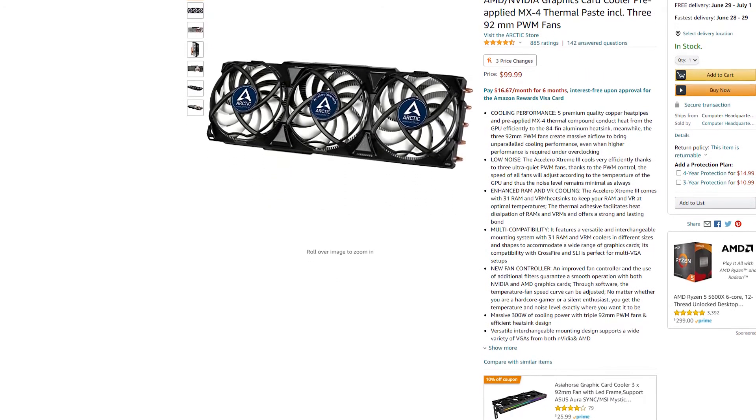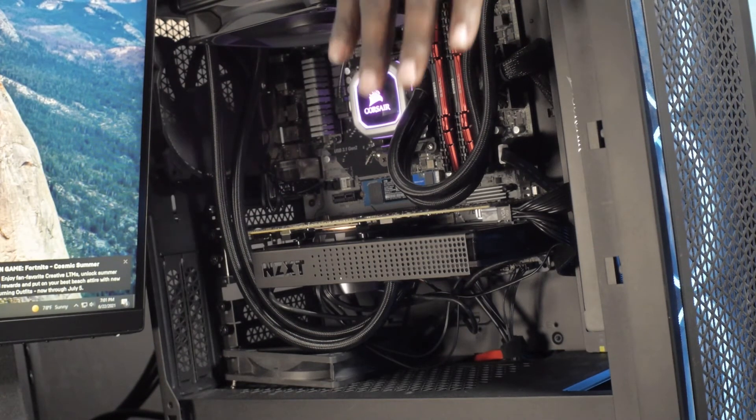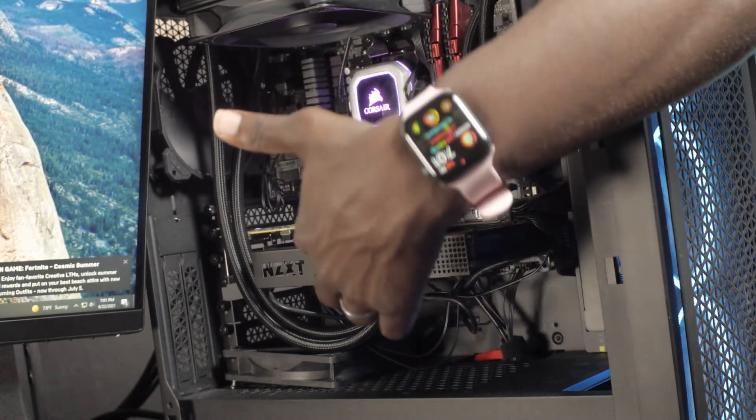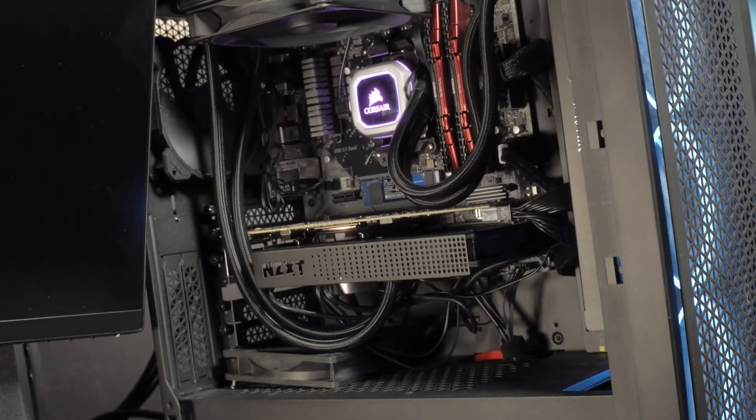Overall though, for something like the 2080 Ti or higher-end cards, it's really not worth it. I wish I had looked into it further. They actually have triple-fan third-party coolers you can just buy for a graphics card, and that's probably going to give you better VRM and RAM coverage and be cool enough where you don't need all this extra stuff. With this AIO setup I had to plug in the AIO fan, find a slot for the fan on the bracket, find another slot for the extra fan I added under the card for VRM cooling, and it also takes up a USB 2.0 slot on the motherboard since this is a software-controlled AIO. That's a lot of extra cabling. A triple-fan cooler might have three fans but you can get a splitter and use one fan header — it seems like a lot less hassle.